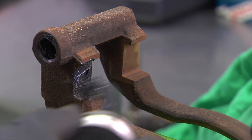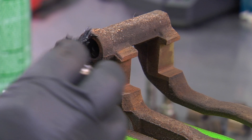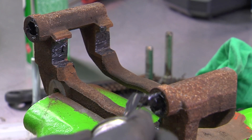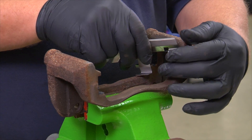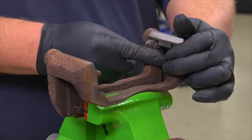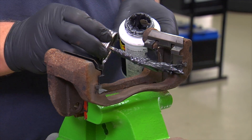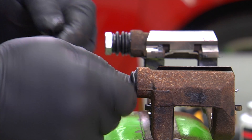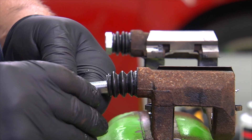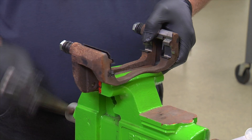Apply synthetic brake lube to the surface of the bracket where the abutment clip will rest. This will provide a moisture barrier to retard the development of new corrosion under the clip. Apply synthetic lube to the pin bore, but not too much and not all the way to the bottom — too much grease will keep the pin from traveling all the way down in the bore, and the caliper won't go back onto the bracket. Re-install the pins and abutment clips, then apply a thin coating of lube to the clips and pins. The cleaned bracket is now ready to be reinstalled on the vehicle.